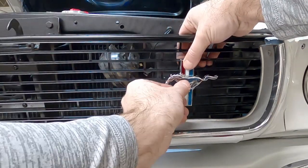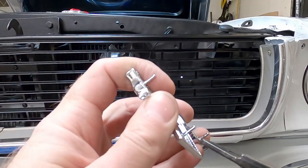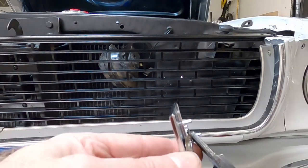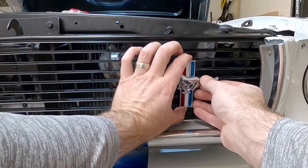That's where the pin comes through, and that little clip - that's when you're going to push it on and push it on tight. Now you could get away with not cutting off these two pins, but it's going to affect the height of this, so I'm going to cut those off real quick. This again is one of those things where it's a one-time deal, so if you do this be prepared that you only get to do it once. With those pins removed, we're going to be somewhere right around in this area on the grill. What I'm using to gauge where this goes is that fastener down there and this rib right here - I'm going to center this thing above that fastener and on this rib.